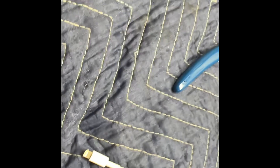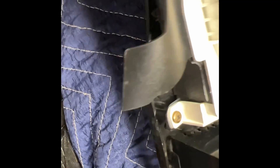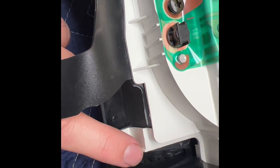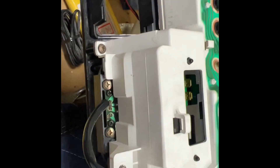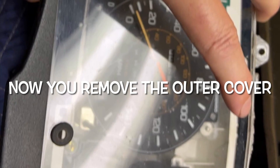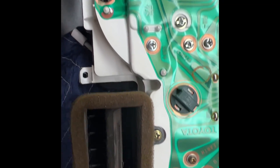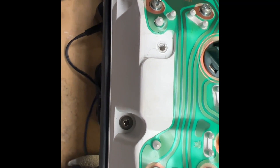And there's one over here. On the back side, you essentially have these screws here. Also, disconnect this clock connector, which has already been disconnected — that plugged in here. Remove the Phillips head screw here, and Phillips head screw here, and Phillips screw here, and the bezel will come off.